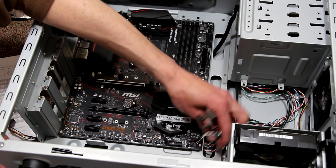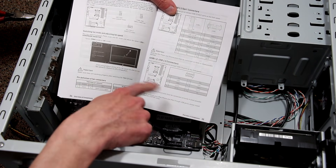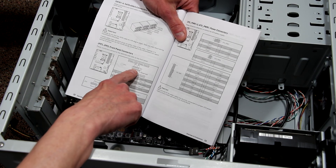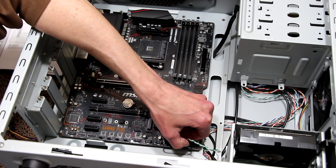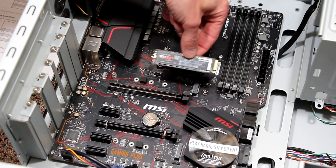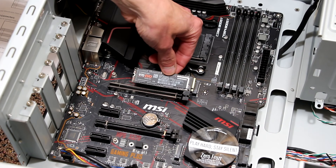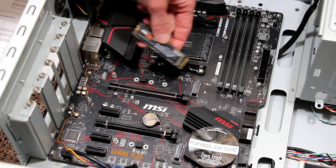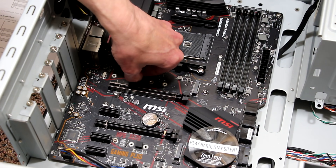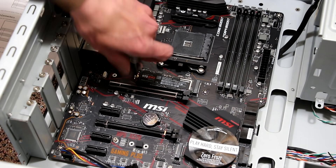I'm going to try to connect some of these wires as I go. Right now there's this bundle of wires here that connects to terminals right here in this area. You want to take a look at the manual for your motherboard — it's going to explain where everything needs to go. Here in my motherboard manual, it gives a diagram of where everything needs to go, so you just have to find the one that correlates to the connector and make sure those get plugged in the right spot. I'm really taking my time during this process because I want to make sure that I don't plug anything in wrong. And now before we bury it, I'm going to install the hard drive. This is what will be the C drive. These little solid state M.2 drives — this is going to plug in right here, but first we need to move this little standoff over to fit the size of the drive. This also gets secured with a screw.